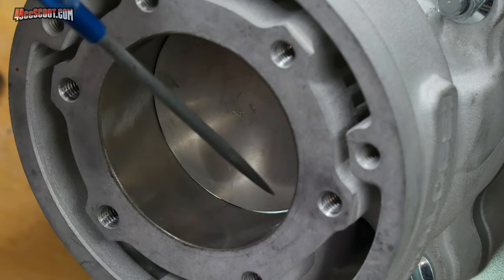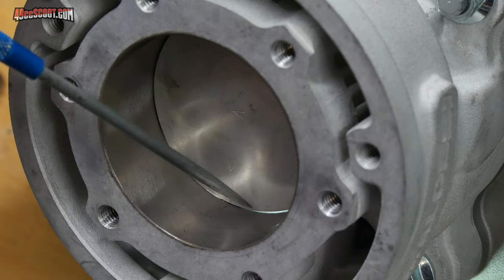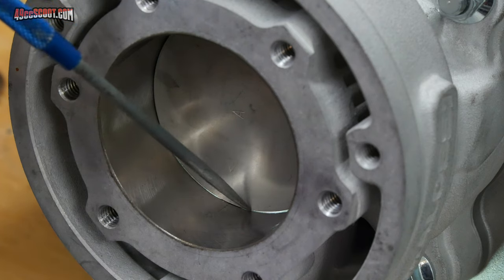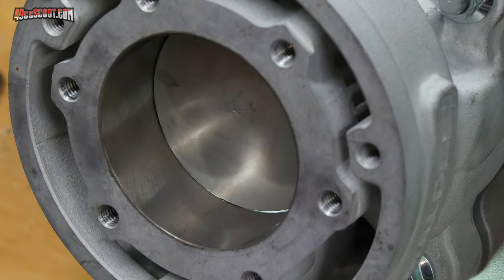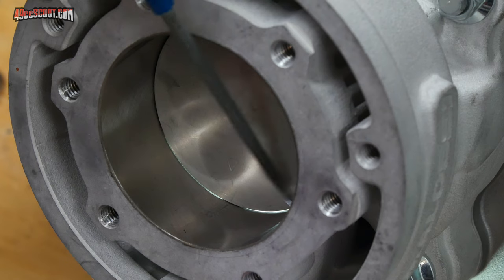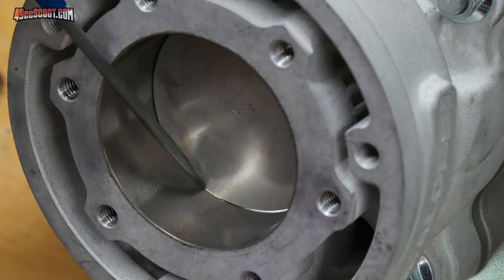I will mention that I'm basically measuring off of one side of the exhaust port that's opening before the other one. So over here, if I'm looking more straight down on it than the camera is, I'm seeing the light come through here, just seeing it come through, and over here I can't see any light coming through yet when I'm at this angle. I'm gonna have to move this about there is where I can finally start seeing light come through here, and this one is actually open more than I'd want. And if I look at my degree wheel now, it shows me about 194 degrees for this one. So it appears to me that there's about a 1 degree mismatch of the openings here.